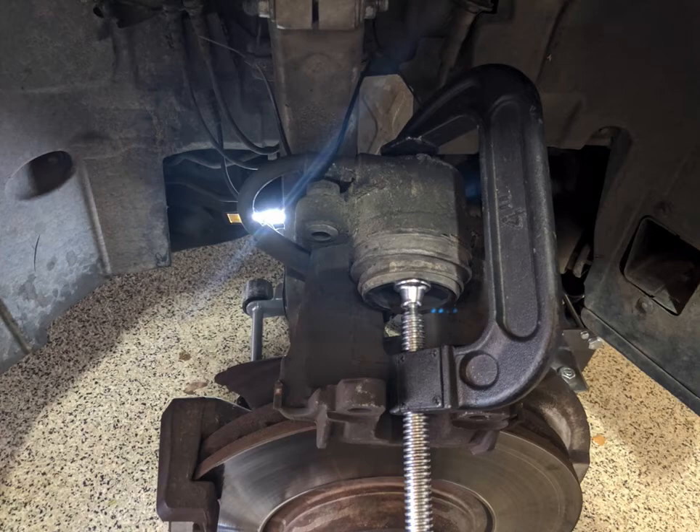Your old brake pads are going to have been a lot skinnier than the new ones, so you've got to press the caliper piston all the way back. I use a C-clamp for this and just crank it down until it's all the way back. You should ideally use something flat that distributes the pressure to both sides. One important thing: you first need to have your brake reservoir open, and you probably need rags around it because it's very possible that it will spill as you press the caliper back — it forces that fluid back up and out of the reservoir. Mine didn't leak, but it was really, really close.